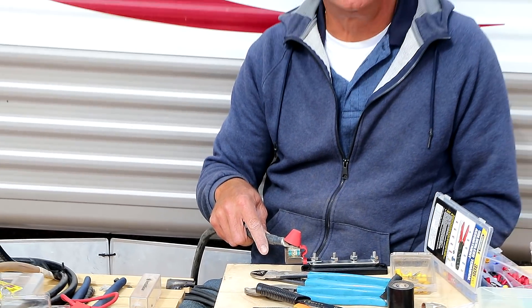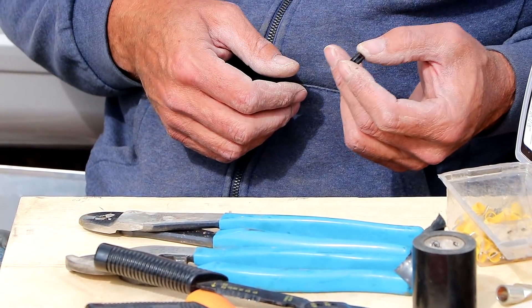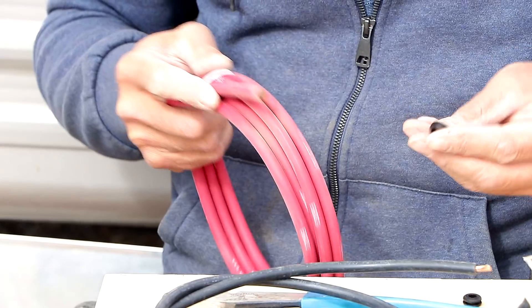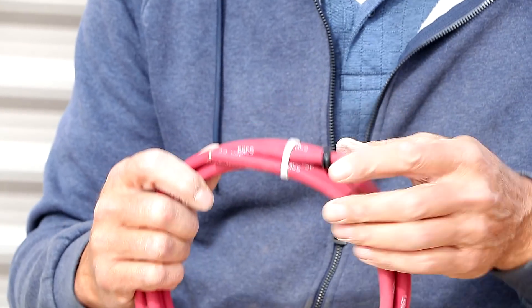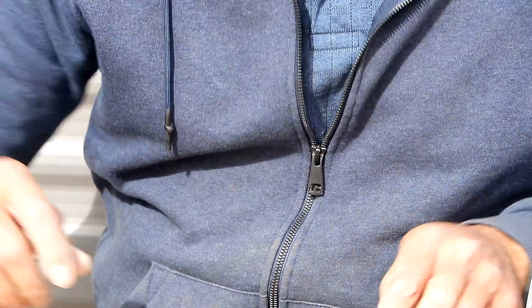When you're drilling through a wall, you don't just want to stick your wire through the wall. The movement of your vehicle is going to cause the insulation to rub off, and there's a good chance you can short out your wire. Several installs I did this year were exactly like that — things weren't working and I found where the wire was rubbing, the insulation came off, it shorted out. One lady lost a really nice $300 charge controller. This is called a rubber grommet. Drill out the proper size hole for the grommet, put that in there, run your wire through it. Now this wire is protected by the rubber — the wall on the outside isn't going to tear into the insulation of the wire at all. You drill your hole just big enough for the grommet, and then the grommet protects the wire.